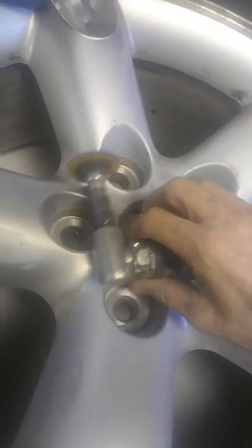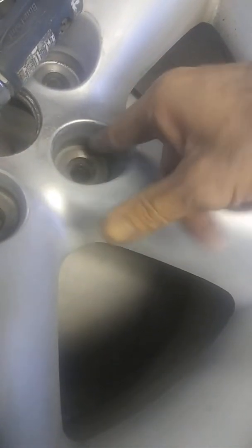Still debating whether I want to polish these or give them a brushed nickel finish. If I polish them, I'm gonna have to take my time and tape these off and cut them out with a knife all the way around, then do my silver. I'm painting the wheels - they have chips and stuff I'm sanding out. I was red scuffing them so the paint knits to it good, then thinking about putting a piece of red scotch bright then gray on there, down in that hole, just to make them shine a little bit.